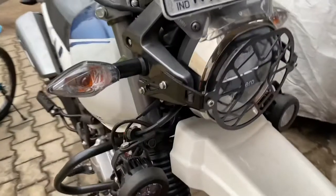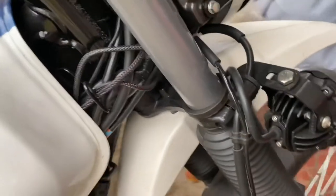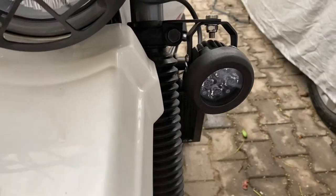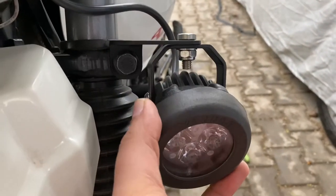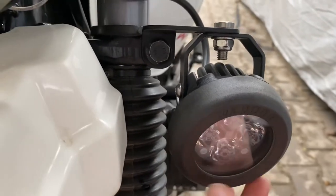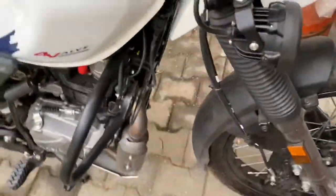Apart from the wiring harness, the extra wiring harness is here — one goes to the switch and two go to the LED fog lamps. It's an auxiliary lamp and it's a dual one. I put a filter here: a white filter for auxiliary use, and if you put a yellow filter it becomes a fog lamp — so that's an upgrade option.